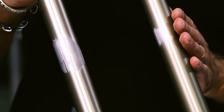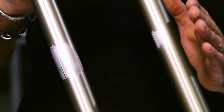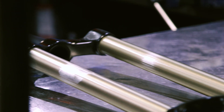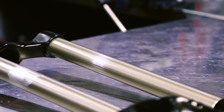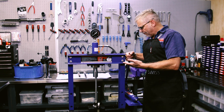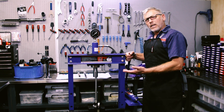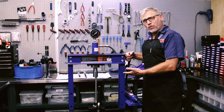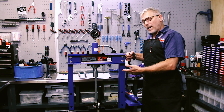Last but not least, we will discuss and show you how to solve the problem of damaged stanchions and show you how we replace them and refit new ones. We're using a 12-ton press for this operation. This press will make sure that it's safe to push the stanchion tube and steerer tubes out of these CSUs as well as put them back in safely.